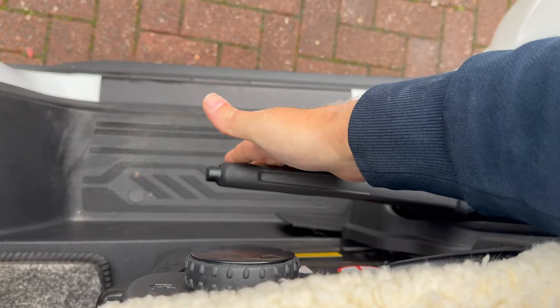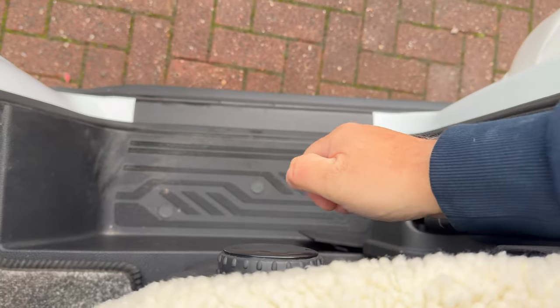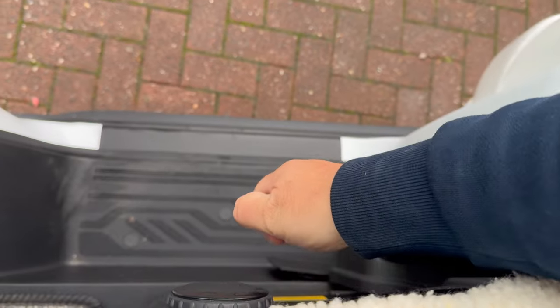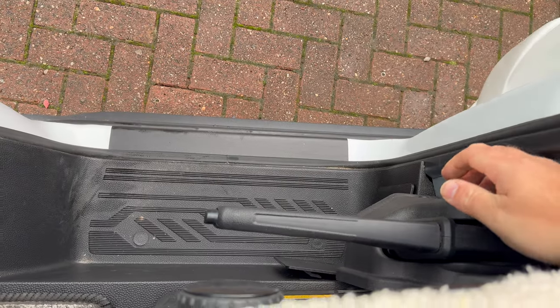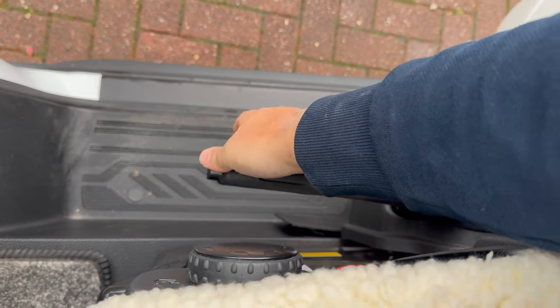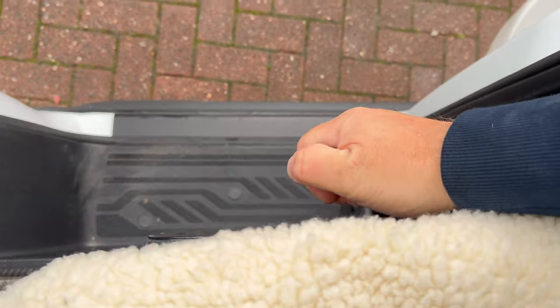While we're in the cab, a quick note on the handbrake on the Transit base — it's a little bit annoying. You need to keep the button in, pull it to the top, keep your finger on the button so you can go right to the top, then drop it to the floor and let go. Don't just drop it down because it won't unhitch and you'll be stuck. It takes a little practice but once you know how, it's easy — it really is.